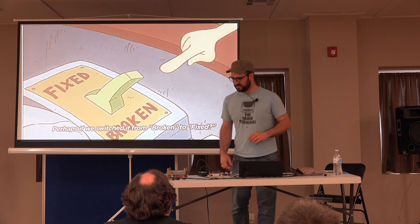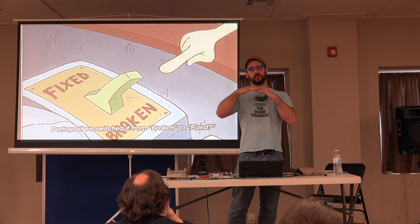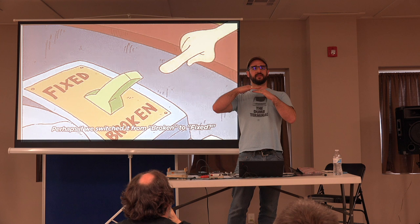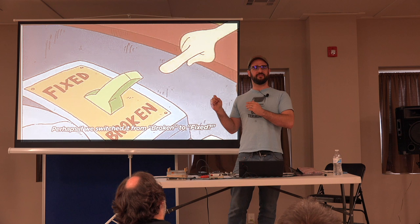One thing that you have to be careful of in a hard drive is that the head doesn't actually touch the disk while the drive is running. The disk spinning around creates a rush of air that pushes the head off the disk very slightly. And if you get a piece of dust or lint or anything else, lint is pretty big compared to that gap, and it'll get in there, and then the head will hit it, and you'll hear this little ping sound as the drive is running, and that is the sound of a bad sector being created.